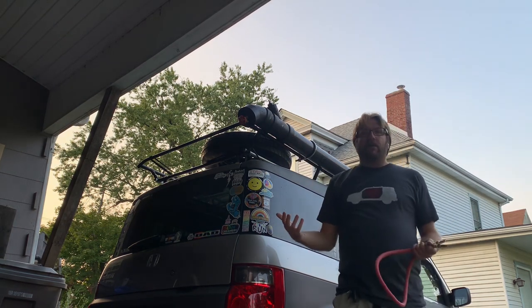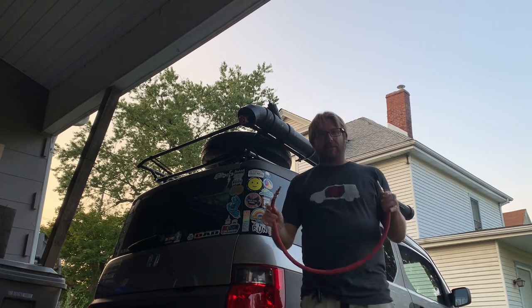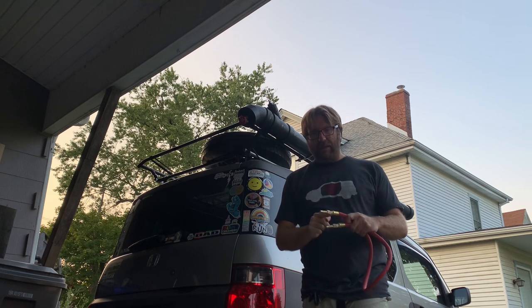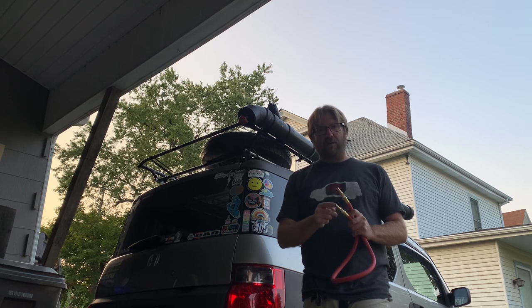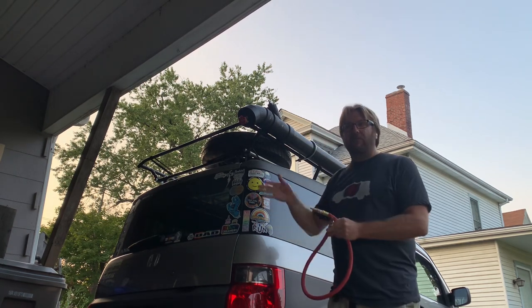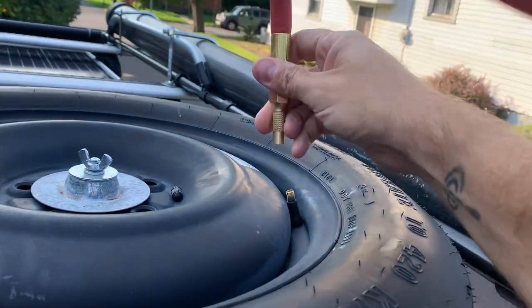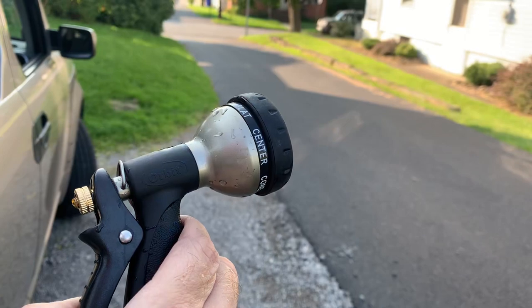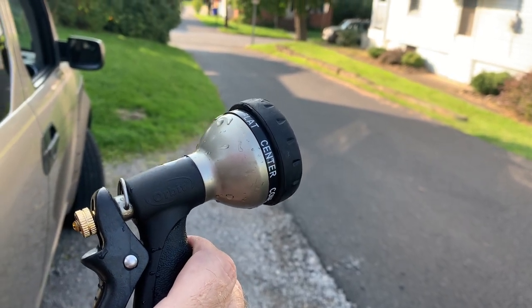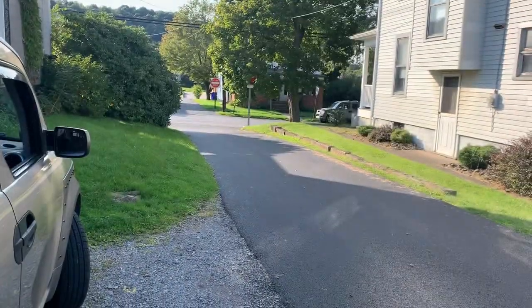That got me thinking: what about a separate air tank? And I've already got one mounted on the roof — my spare tire can act as an air tank. I purchased a short length of air compressor hose with threaded fixtures at each end, put threaded female Schrader valves on both ends, and I'll connect one to the spare tire and one to the shower. This way, I'm maximizing the water in the shower and using the spare tire as an auxiliary tank to supply the air pressure. The spare tire PSI is set at 60, so that pressure feeds into the tank and I get quite a bit of output from it.